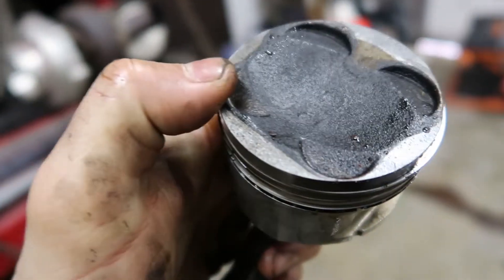I can't see any detonation — actually wait. That pitting here, focusing — that is a true sign of detonation, like it's been sandblasted. This thing has been detonating like mad. Now that rod is gone, the rest actually spins over freely, which is nice. So if all goes well, we might get away with getting a new rod and a bearing and cleaning up that journal. The piston is cracked as well — that's mainly down to detonation, and that's probably why it was smoking so bad. Hopefully the rest of the pistons are okay, but chances are they're also cracked.